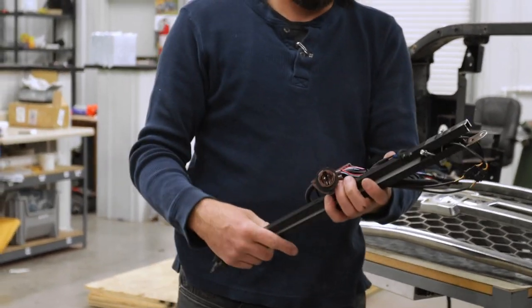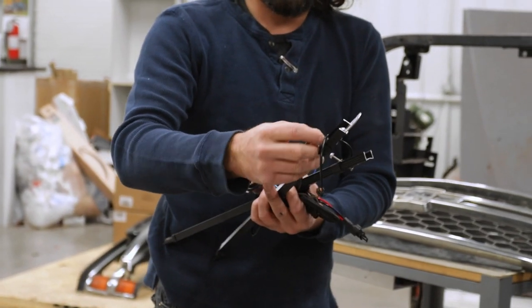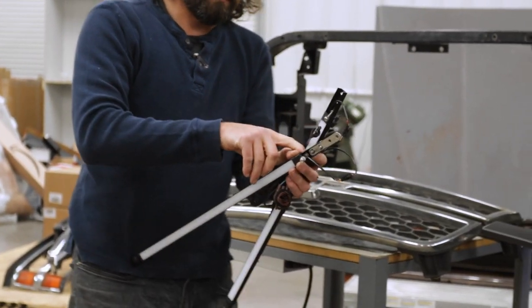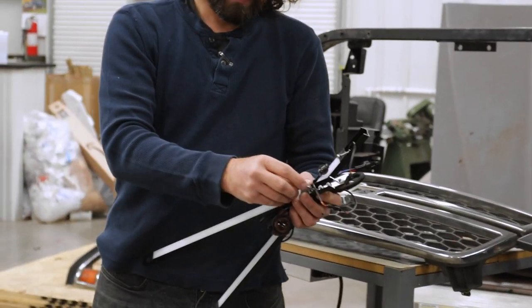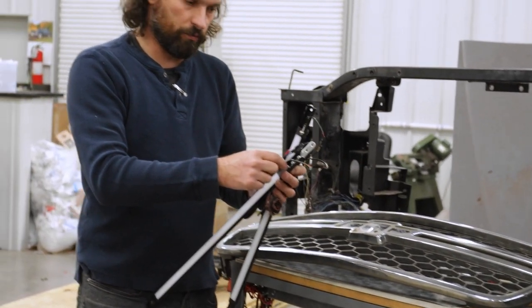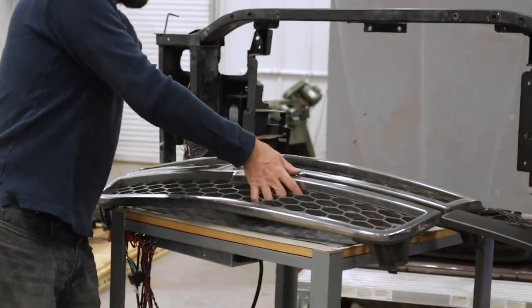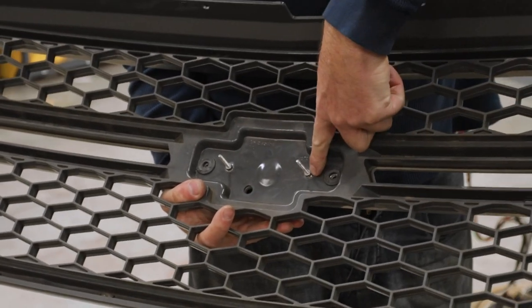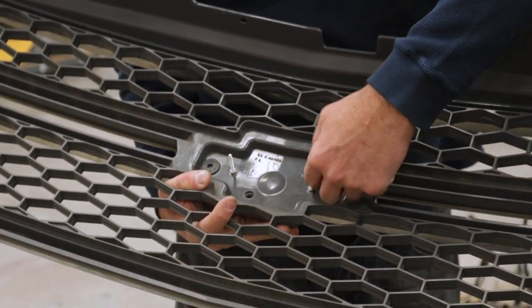This is a wide-only so it'll look kind of like this where these two long number six stainless screws are pre-installed — all the nuts on here are just finger tight. You're going to take all those off, run the screw from front to back all the way down, then add a flat washer and the lock nut onto the back side and tighten it down. You'll need an 8mm socket or a wrench to tighten that down, and a Phillips head on the front. When you're done on the back side it'll look kind of like that. Make sure they're good and snug so that when you tighten the bar down on the rest of the stud, this part doesn't spin.